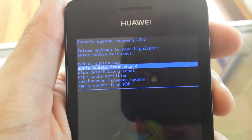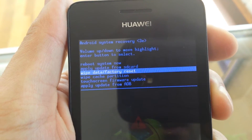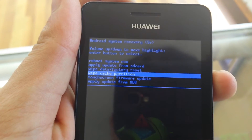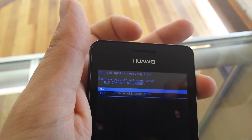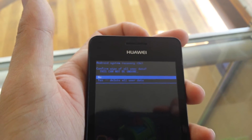I'm just trying to let you see it. Now you have to go to "Wipe Data / Factory Reset" and use the power button to click that. They will give you the option to delete all information. You have to click yes, and this is going to start automatically.